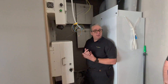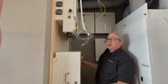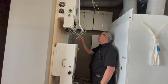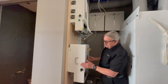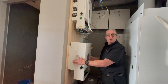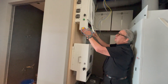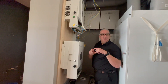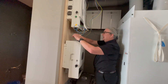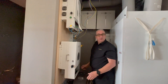We've got three batteries mounted already, so we're going to have to mount the other battery. We need to put trunking in here for the cable run. You're going to have to move these inverters across to give clearance — move them to the edge. We need a metal or plastic trunking: a piece here, a piece here, and a piece there, all joined together.